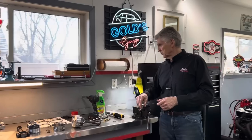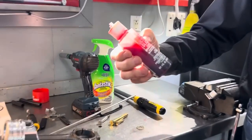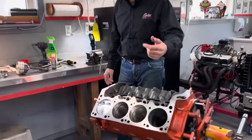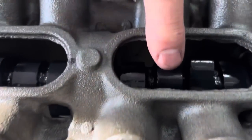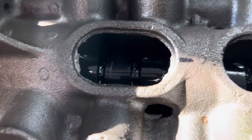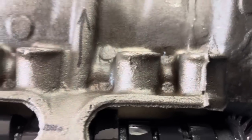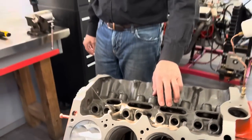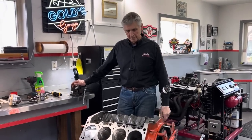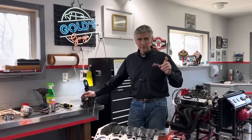This is the assembly lube I use — Permatex. There are all kinds of them and they all work pretty well. One thing I'll show you: I coated this cam with the original Comp Cams break-in lube probably a month ago when I put the cam in, because we've been waiting on bearings for a long time — and it's still on there pretty good. I'll put another coat on before I put the lifters in. With a Mopar it's nice and open so you can get at the cam easily; with a Chevrolet it's not as easy. We also have the pressure gauge set up — we are going to prime this engine and will show that. Please like and subscribe, and we're going to show a clip of installing spiral locks.